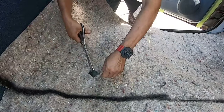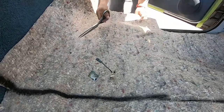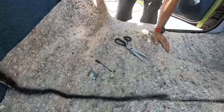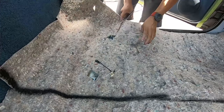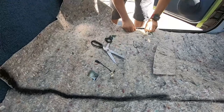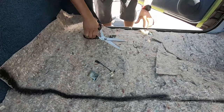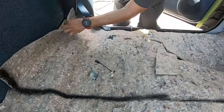See — if I want to unglue it, I just lift part up, and it releases easily. As soon as I put pressure on it and rub it, that glue will stick. But that doesn't mean it will be hard to remove later — if you want to lift the insulation to run a speaker cable, it will be easier to do. I am trimming that insulation — it has to be about half an inch short, because when you're molding it in there, if you run the insulation all the way over the clip, it will be hard to put those plastic trims back.